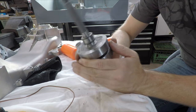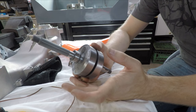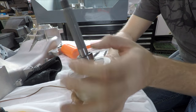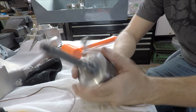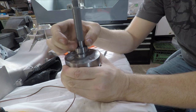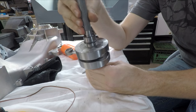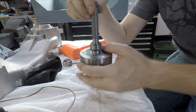Unfortunately my camera stopped recording for a second, but the crank was cold. It's now a bit too hot so I'll have to re-put it in the freezer. You can see it didn't go all the way on — it actually went sideways. I warmed this up and as soon as it got on there, it cooled down and locked on. In that situation, you can't really hit the crank, so you need to get a piece of something that you can put in between the crank, put it in a press, and slide that down. If you put this against something and hit on this end, you're going to throw the crank out of balance.